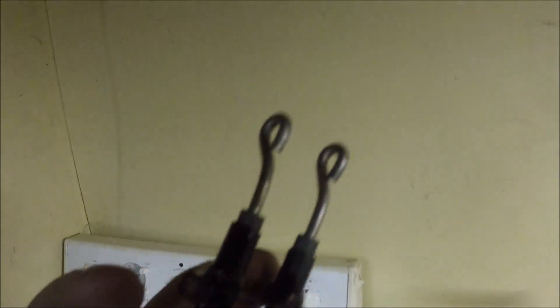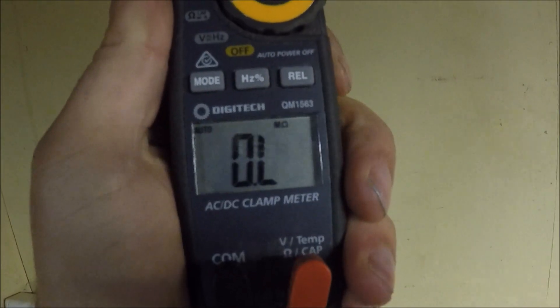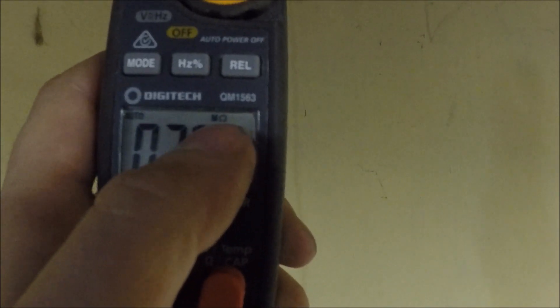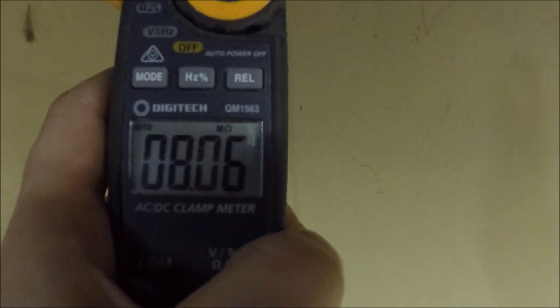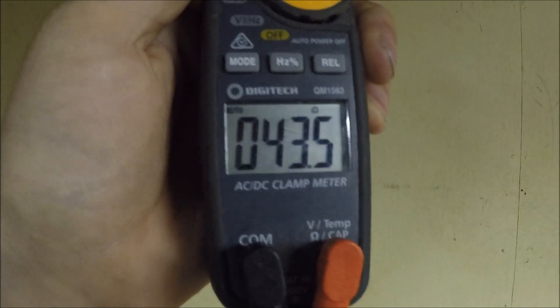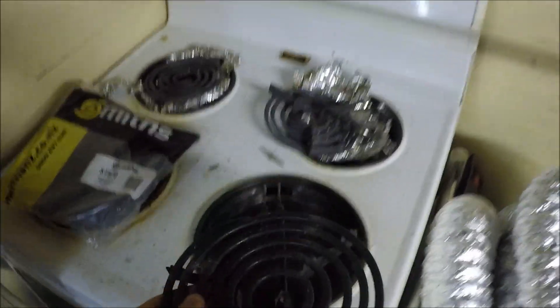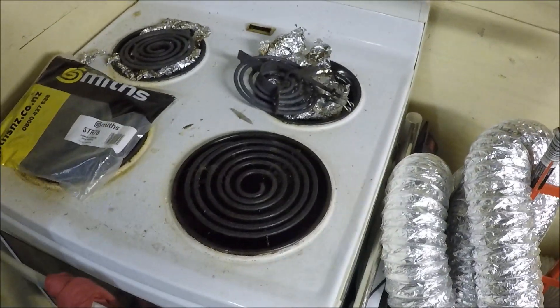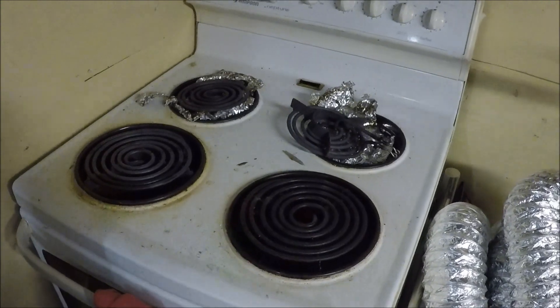OL means there's actually no physical connection between the two ends of the element. So if your meter says mega ohms, the element's stuffed. If it shows OL, also stuffed. If it's got a K and an ohm symbol, also stuffed. A stable low ohms reading is perfectly fine and the element will function fine. To reinsert one of these elements, slot it in there and make sure the ceramic doesn't crumble. Make sure you go and check out my other videos - cheers.